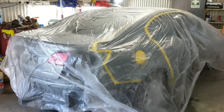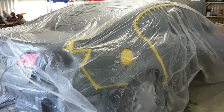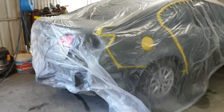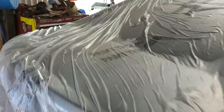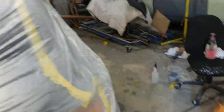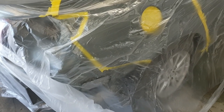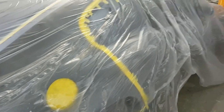As you can see, the bag folds out to a fairly decent size. If you're ever somewhere and there's not an iota of a breeze, I guarantee the wind will pick up the moment you try to bag a car - happens every time. Make sure paint side is down the dead center and it should fold out enough to cover your whole car. I normally do a couple little pigtails at the bottom to turn it into a tight bag on the car, then use a razor blade and masking tape - you just cut this section out and the rest of the car is instantly masked up.